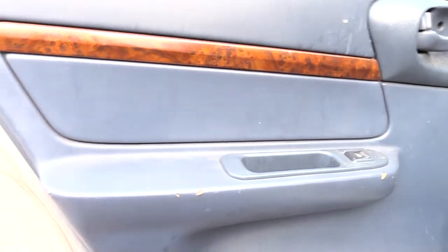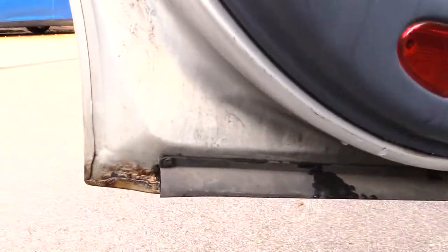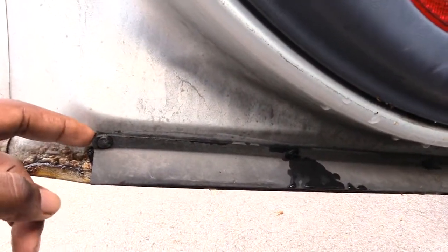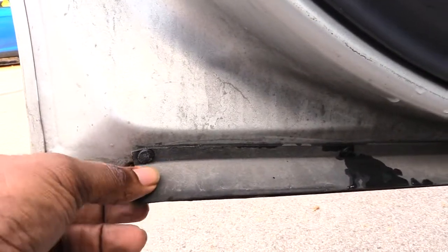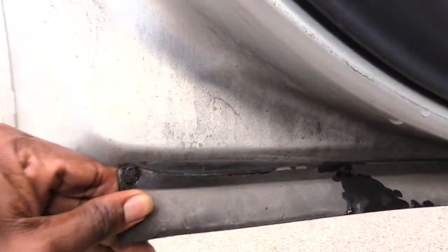What you can do to get this water out — coming down to this door on the Chevy Impala, you go all the way down to the bottom. You'll see this little rubber piece right here that has little things kind of plugging it in. What you can do is just kind of pull on it like that and remove it.